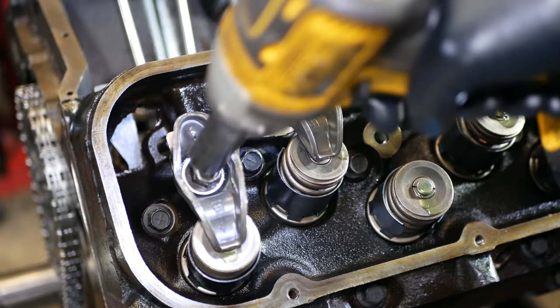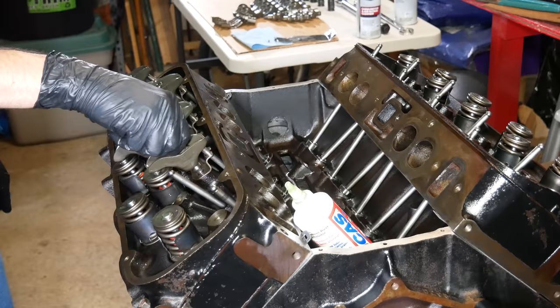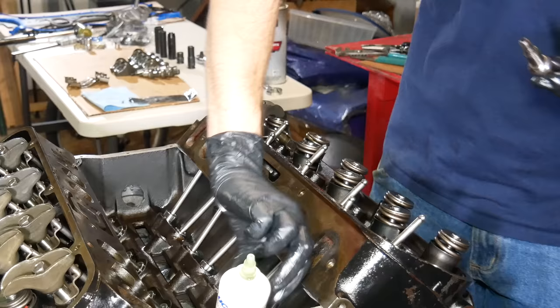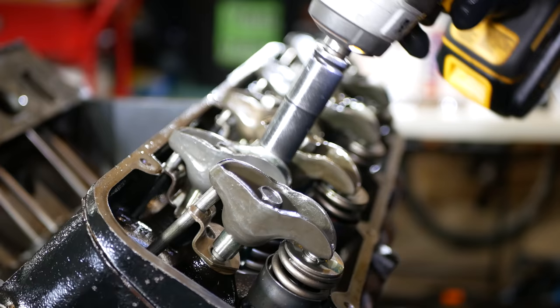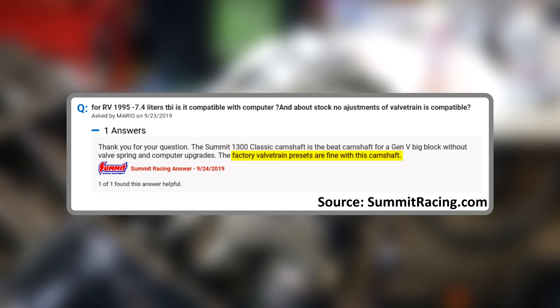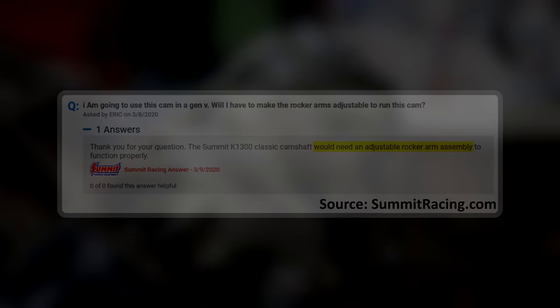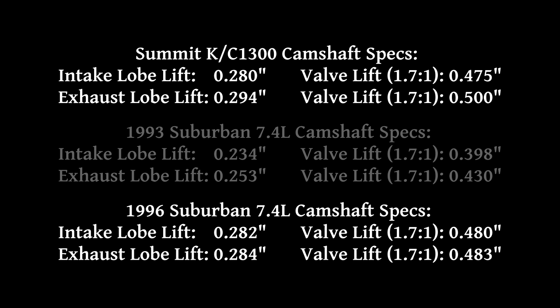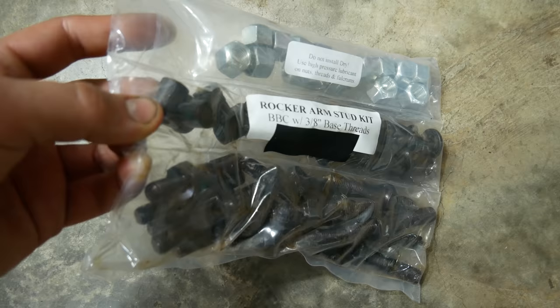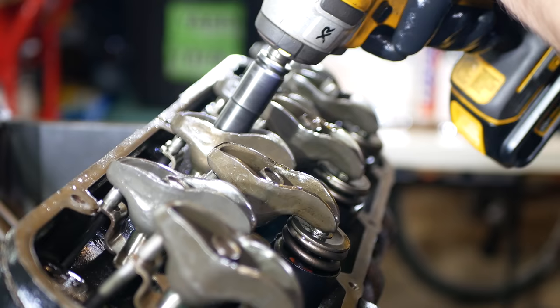We're going to pause here for just a moment to address that net lash rocker assembly that we're keeping. This is the factory-type setup on Gen 5 and 6 big blocks where the preload on the lifters is preset and non-adjustable. I wasn't able to find any super definitive information, but it seems like the general consensus is that this valve train setup is good for up to 500 thousandths at the valve. Even the customer service reps for the camshaft brand are a little fuzzy on that — on the product page for the C1300, which is just the cam itself, a rep said it is compatible with the stock valve train, but on the product page for the K1300, which is the cam and lifter set, a rep said it is not compatible with non-adjustable rockers. The best evidence I have that everything should play nicely together comes from GM themselves — the '96 to 2000 engines had more lobe lift, in fact pretty similar amounts to this aftermarket camshaft. So I'm pretty sure we'll be fine with it as is, but if it seems like something isn't jiving quite right we can switch over to an adjustable stud system.